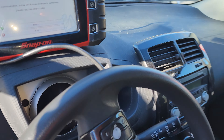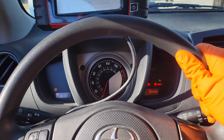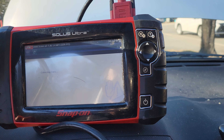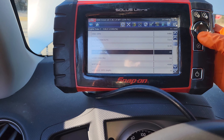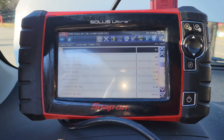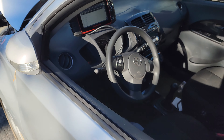So we're gonna pop in here and go ahead and fire it up. I've got it in neutral with the e-brake on, and I'm using my scan tool to monitor the coolant temperature so we can see how quickly it increases. I just fired it up — it's at 50 degrees, the ambient air is 46 degrees, and you can see that temperature is climbing already, climbing quite quickly. Another red flag.